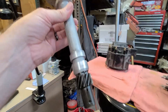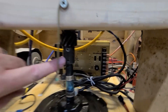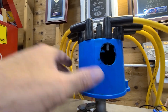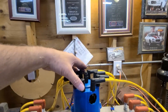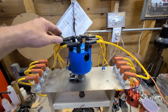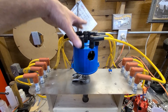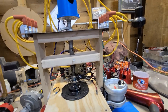When you put it on, voila — the hole is covered up except for your wires coming out for your magnetic pickup. This has the little dimple on the gear with a roll pin, and the rotor is actually in line right there too. If you're picky and want your distributor to sit just right — and that's where your timing is set — you're good to go. If your distributor is off a little, you can pop the gear off, turn it 180 degrees, and put it back on, and you'll be able to get your distributor to sit just right.